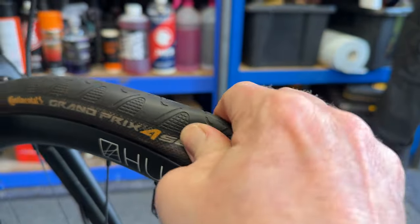Now before we look at the problems let's first of all look at what you think may be a problem, but in fact it's just tubeless. When you run tubes you return to your bike a week later and the tire pressure is in exactly the same place as when you left it. You switch to tubeless and you lose 10 psi every time you go back to your bike. This is just normal — sometimes tubeless just does that.